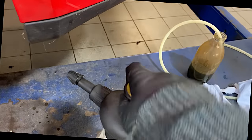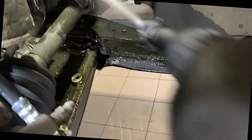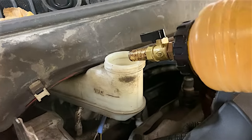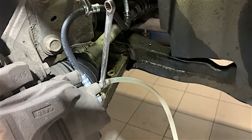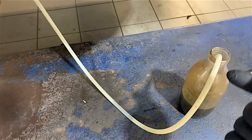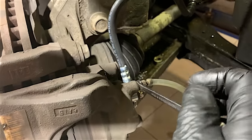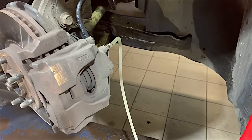As there's brake fluid all over the place, brake cleaner is very good for cleaning it up — I'll give that a good spray over the subframe, the driveshaft boot, and everywhere else there's brake fluid. Top up the brake fluid. To bleed the brakes I need a pipe going from the bleed nipple on the driver's front caliper into a bottle half-filled with brake fluid so air can't be sucked back. Let's see if this bleed nipple loosens — yes.